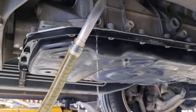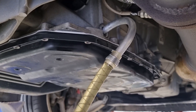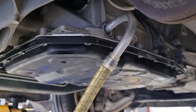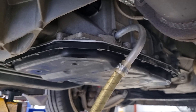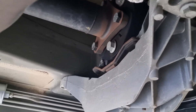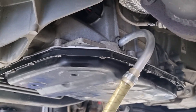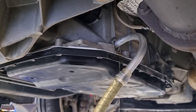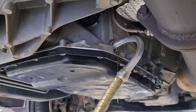Start the car, Joe. As you can see it stops flowing out — that's because the oil is being pumped around the gearbox now, so we'll keep pumping some more in. You can see that Joe's pulling it through the gears. You can see how much extra we're pumping in — this is really important that the car is running at this point and in drive, so we'll leave it in drive and make sure the oil is getting pumped around through the valve body, through the oil pump and the cooler and everything.